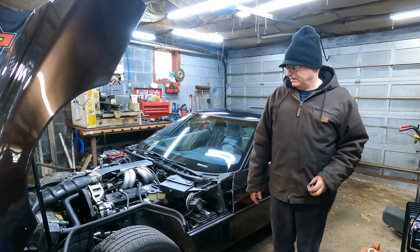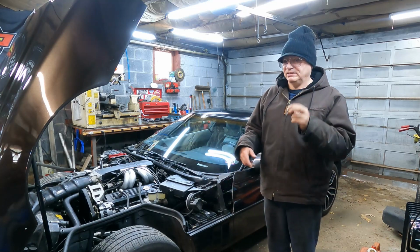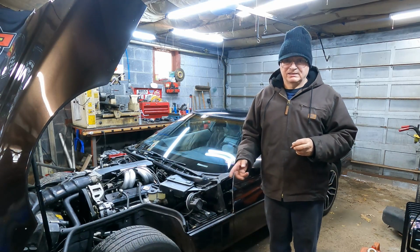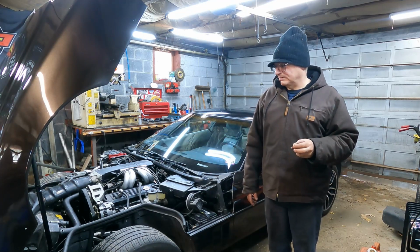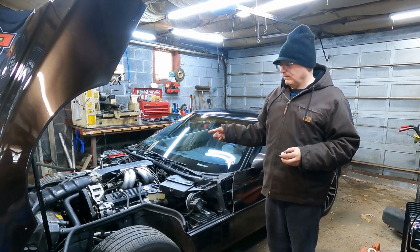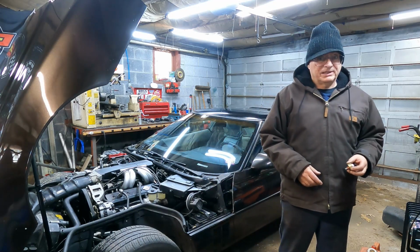All right. After getting drenched up to my armpit in coolant, I got the new knock sensor out, the original one back in, and I'm going to start it up and hook up my scanner, and hopefully that fixed it. I won't know till I start it up. I know I did eliminate that I'm getting false knock from where the wire runs behind the distributor, so at least I eliminated that. So here we go.